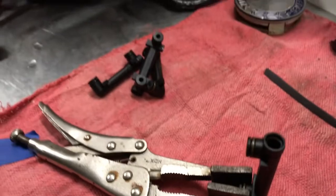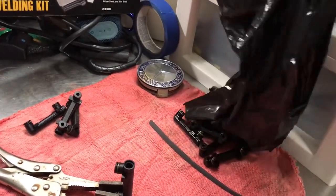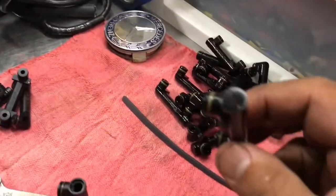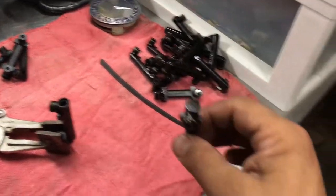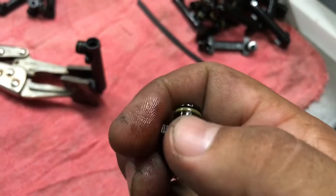And maybe throw some soapy water up front to see if it holds. I think it's going to hold — I haven't seen anyone else on YouTube do something like this. I also have another set here, an old complete set. I got it from one of the members of one of the Mercedes clubs on Facebook. I got all 16 of them. Obviously you want to clean the ends off, get the oil off — I'm going to clean it with some CRC, which is pretty good on plastic. All these ends have blown off, so I'm going to just lightly weld around the edge, all around, and keep this cap from blowing out.